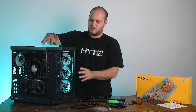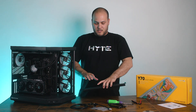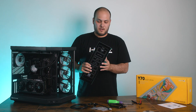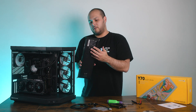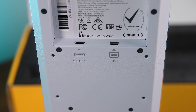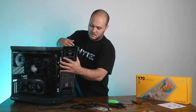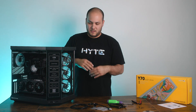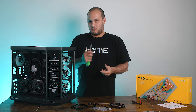Now that we've gotten the screws out of the glass channels, I'm going to go ahead and get these two from the top. Now that we've gotten all four screws out, we can just sort of lift this corner panel out. Set this somewhere out of the way, and then we can go ahead and install our display. Before you place the display in the case, I do recommend taking note of the mini DisplayPort and USB port up on the top edge of the back of the screen, because when you have it in the case it may be a little harder to see these. Placing this into the case is basically the same as the glass panel that came out before, and we're going to do the installation in reverse — starting with the top screws.